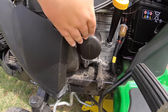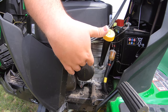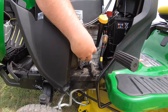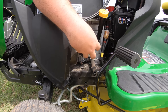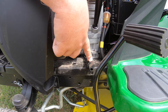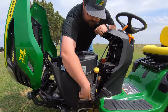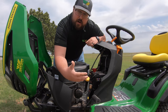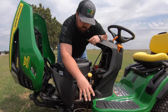Next is our oil filter, conveniently placed right next to the oil fill. With that panel moved out of the way, it's very easy to get in here with a filter wrench or strap wrench. Then we have our oil drain system — it's poked out and away from the frame so you can get an oil pan underneath when doing service at home without making a mess. It's meant to be opened by hand, but there's also a small square hole that accepts a quarter-inch ratchet if needed.